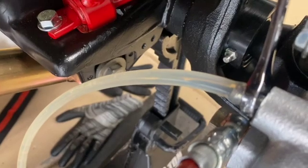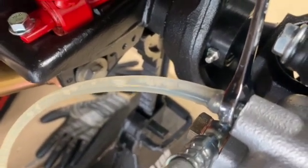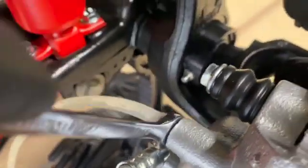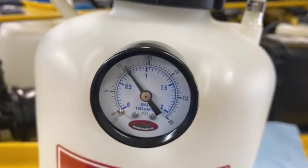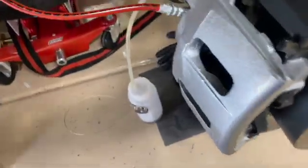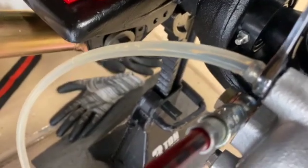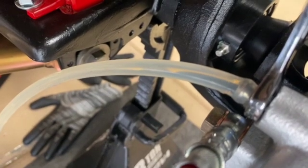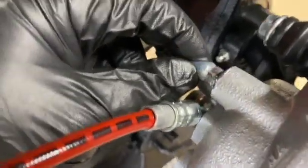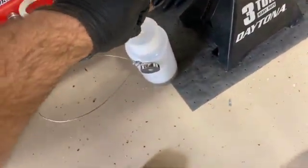So let all that stuff run clear. I'm going to stop it right here and go check my tank. I still got some in there — I might want to add a little more before I do the last wheel. You can see I lost a little bit of pressure because there's a bunch of air in the lines. Pumped it back up, just make sure I have enough and let's go bleed it. So we're back at the front right. Crack it. There we go, pushing air out. That looks like it's running nice now — solid, no bubbles. I'm good with that. Tighten this thing up and we'll move to the other wheel.